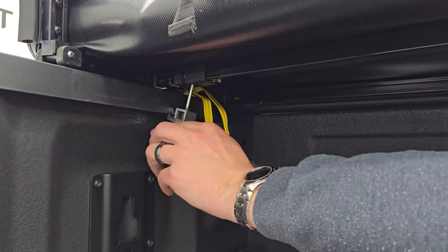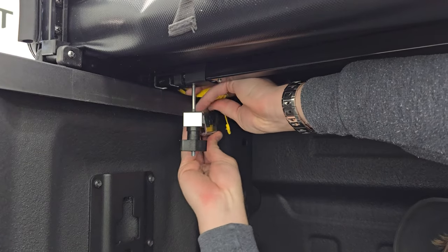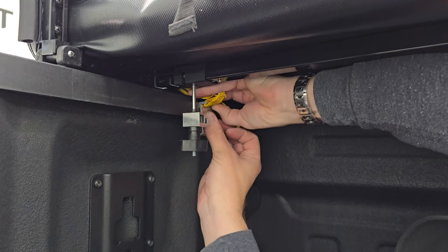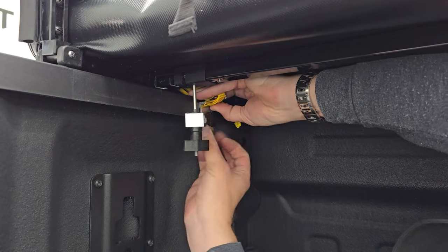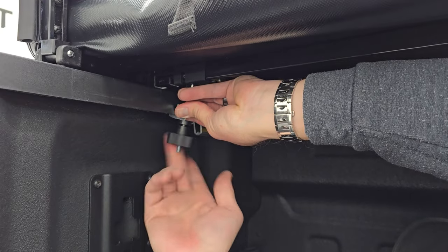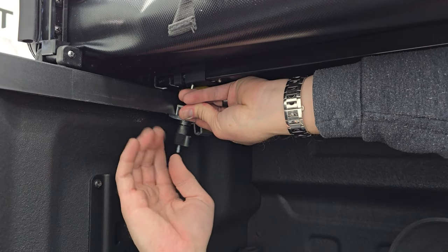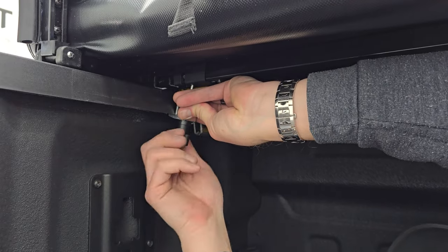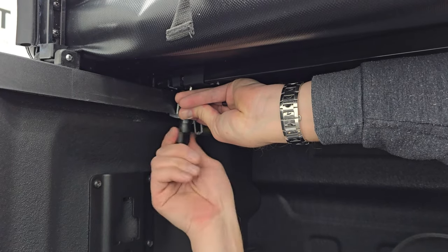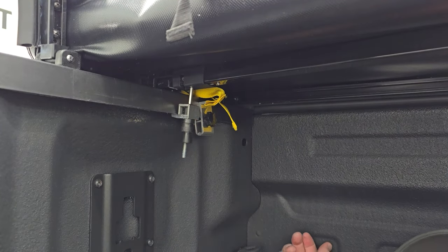All right. So you'll notice that there's the main clamp and then there's this safety clamp here — this is like just an extra safety. You're going to want to get that up there and just spin that until it's tight. It's kind of a double safety feature in case the tonneau goes whipping so it's not going to fly off in traffic or anything. And then this piece just goes under the lip of the bed rail here. Now if you have a drop-in bed liner, you may have to cut into the bed liner to get this attached — you would just need a tool to cut into that bed liner. Now you just want to get it nice and snug so it's not going anywhere. Make sure this safety one is tight and we'll go to the other side.